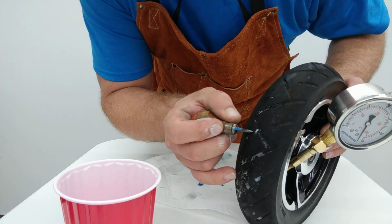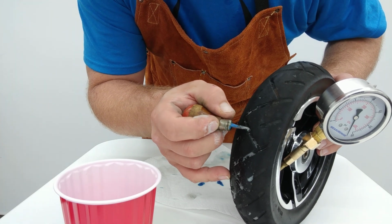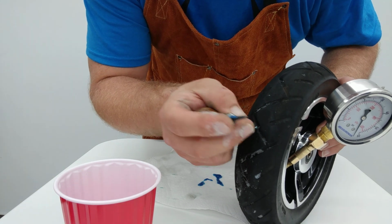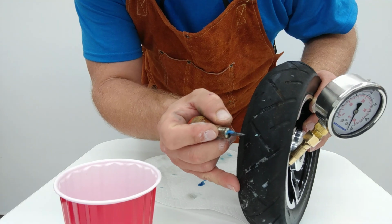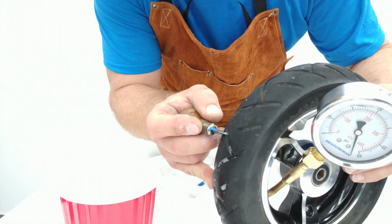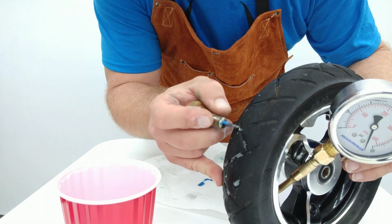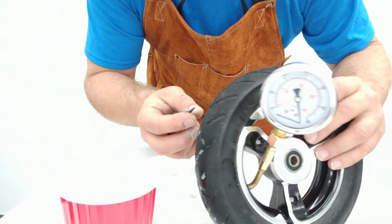See how we have a little bit of fiber sticking out of here? We're going to bring that up so you can really see it. But see these fibers? Those fibers are the long Kevlar fibers that we use in our product. You can see how they've formed a net and they've brought themselves outside of the tire. And inside of this, if you were to look closely inside the tire, what you'll see is there's a net made out of this material that's packed full of rubber particles, which are keeping the tire from leaking further.